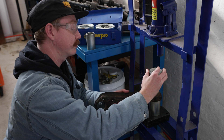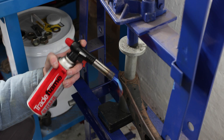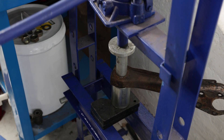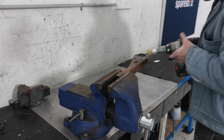Take your crusty arm and press out the old bush — this is obviously the nice new one. The old one should come out without too much of a fuss, and if you need, you can use a bit of heat to help things along. Once you've done that, in this case because these arms are from a 50-year-old car — relatively ancient, some would say — we wire wheeled them back to get rid of a whole lot of crud, road grime, and a bit of surface rust.